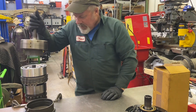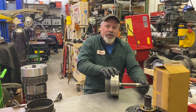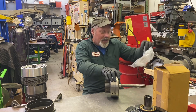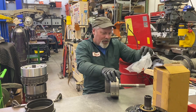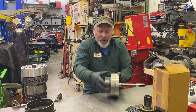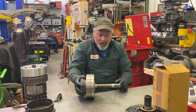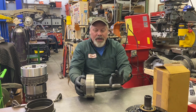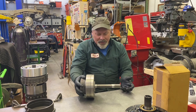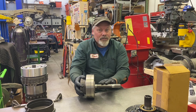Forward drum. The drum itself just showed up yesterday, which is why I continued to work. It's an ATI. It has a torsional input shaft — I noted this on the Copo transmission I fixed a few weeks ago as well. They're actually torsional — they're made to twist instead of break. I'm not sure the horsepower rating of this, but it's plenty more than a stock one. 1,200 to 1,800 is a piece of cake for it. It's designed to twist right here and comes with much larger splines broached into the drum.